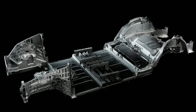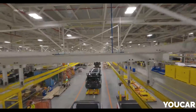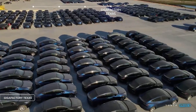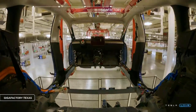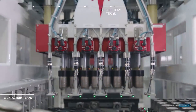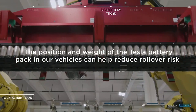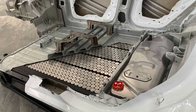The structural battery pack is the final piece of the puzzle. This is another manufacturing advancement that Tesla has already put into use on certain variations of the Model Y at Giga Texas. They use their new 4680 battery cell — a very wide diameter cylindrical battery cell with a solid steel canister. They sandwich those batteries between two sheets of metal and fill the voids in the middle with a solid urethane foam, creating a solid brick of metal that is filled with batteries, and that is what connects the front and rear gigacastings together. This is very important: if we go back and remember how the traditional pickup truck carries its own body as dead weight, a traditional electric car carries its own batteries as dead weight as well. The frame and the batteries are separate. The structural pack integrates frame and battery into one component, so now the vehicle isn't carrying the weight of the batteries — the batteries are carrying the weight of the vehicle.